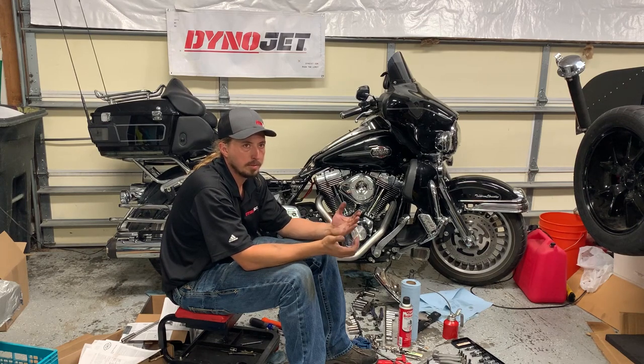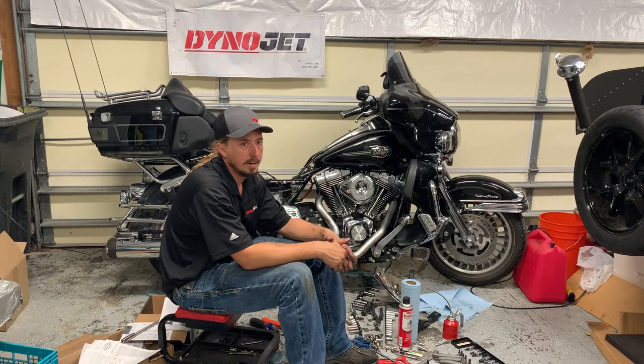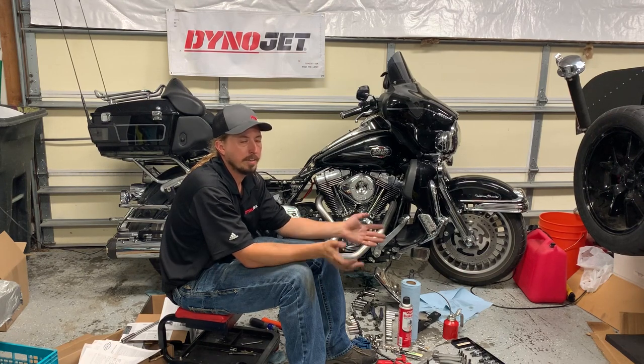One special tool that I needed to buy that I didn't expect to need, but I should have expected, was the cam bearing puller tool. You can make a decision about whether you want to leave them in or not, but as Joe pointed out when I asked his opinion, you're in there already, and the new bearings are substantially better than the old ones, so you may as well do it.